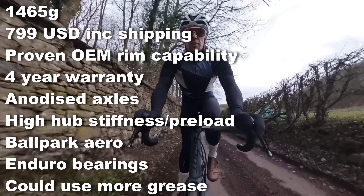Disc alignment — I've covered this with other hubs in other videos. It's quite annoying when using different wheelsets to have inconsistent disc alignment. These have got that spot on, which is a machining tolerance on the disc mounting interface. Preload tolerances of the bearings are spot on too. These hubs actually look very similar to the DT 240 shell. Redundancy — basically, are you going to suffer catastrophic de-tensioning or de-lacing? No, because these have fully enclosed spoke holes. Some very lightweight straight-pull side-entry hubs on the market lack any redundancy, so if spokes de-tension they can all pop out sideways.